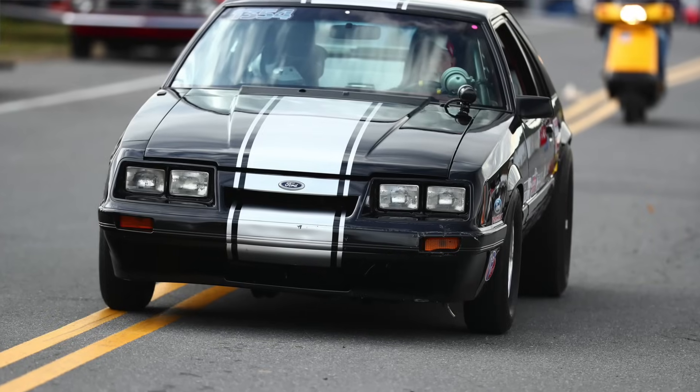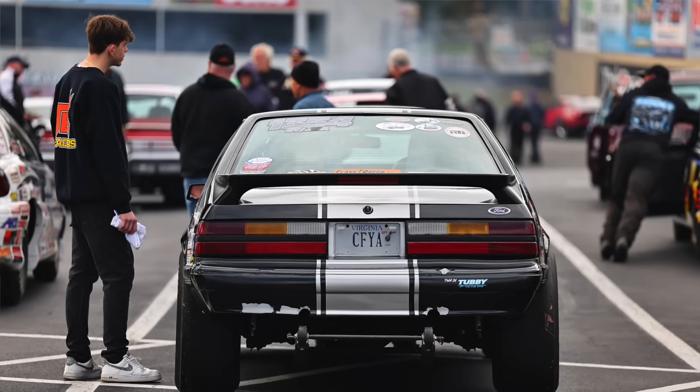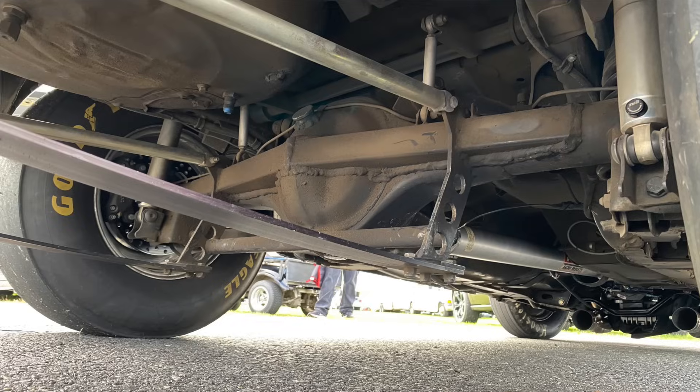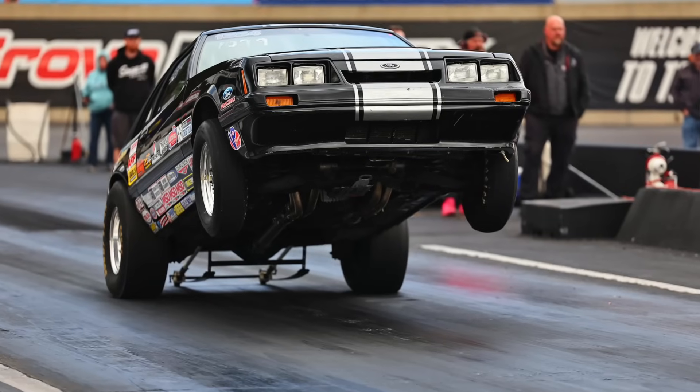So Dwayne, this thing's been a Cleveland for quite some time, right? Yeah, about 97, 98 when I first started running it. We started as an IHRA stock GT car. When IHRA folded up and didn't have any classes anymore, we just put an air shifter and trans brake in it and started running Superstock. What rear suspension's in this? Stock — the upper control arms we made way back when because they didn't offer them, and the lowers are just boxed stock ones. Fox Body suspension for drag racing — they love it. This thing is easy right from the start, and I've been watching it stand up for years.